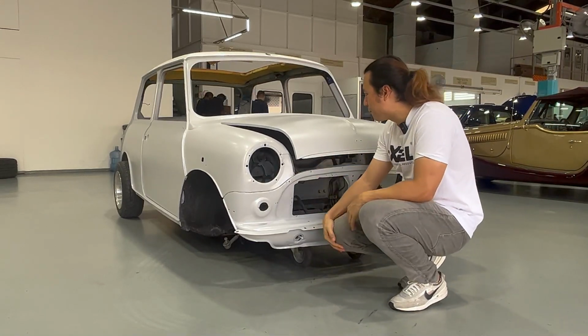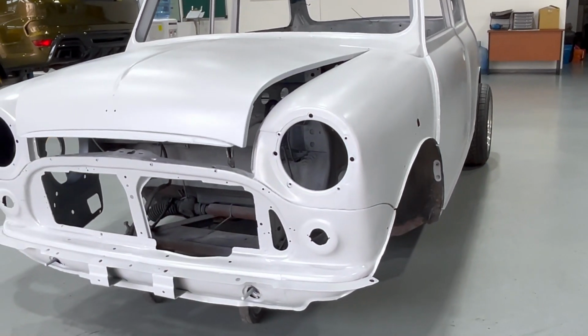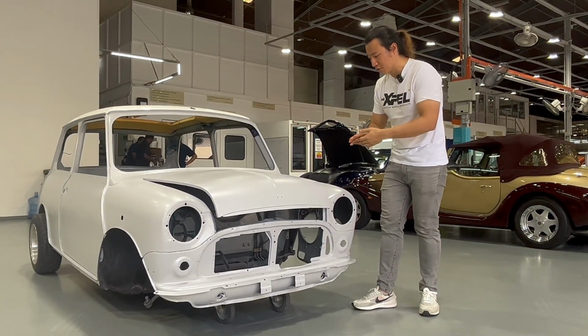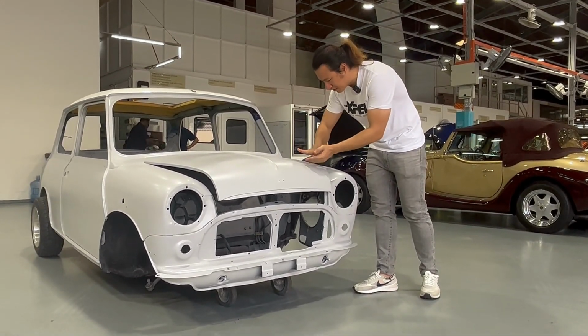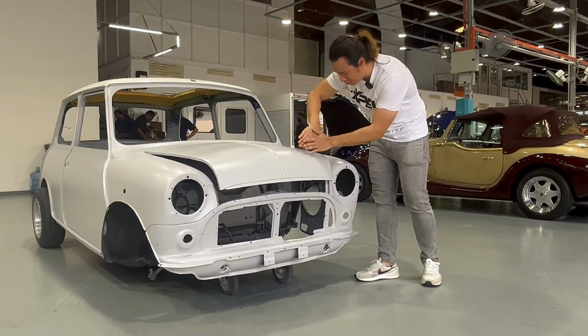Now, the other thing that happened was that my body was sanded down using a machine. It sounds like a logical thing to do because you want to get rid of the paint. But the problem with sanding, if it's not done properly, is what I learned from the last encounter, and Jerry showed me, that when you sand everything down, the machine doesn't really sit flat all the time. Okay, it's like polishing, right? And sometimes you may cut more in one spot than another.